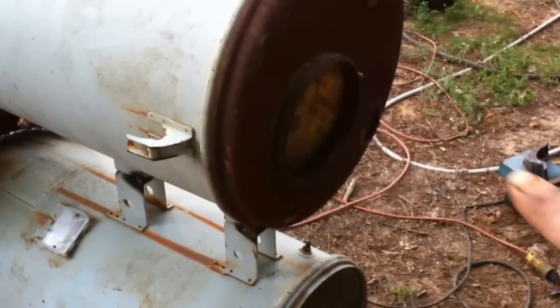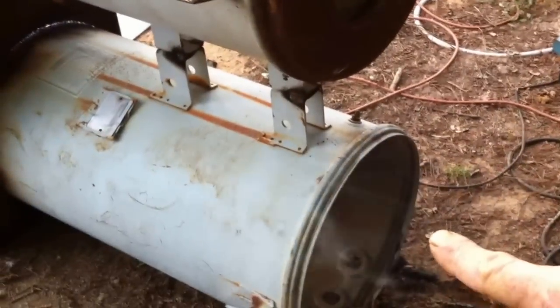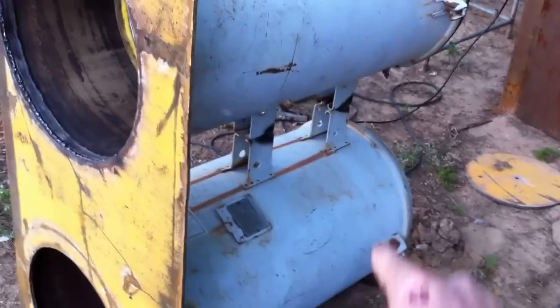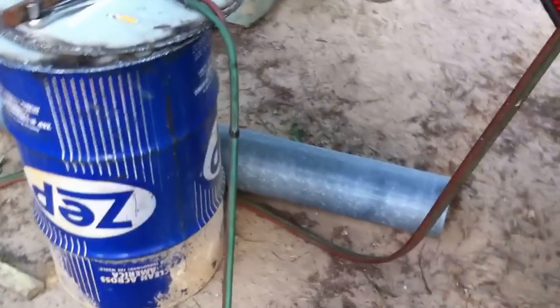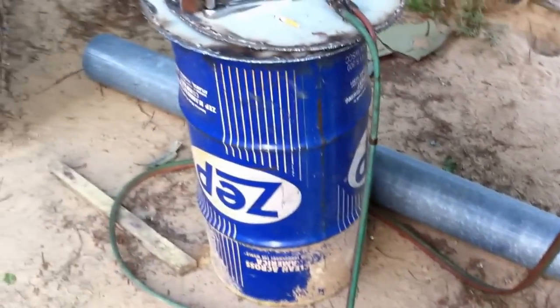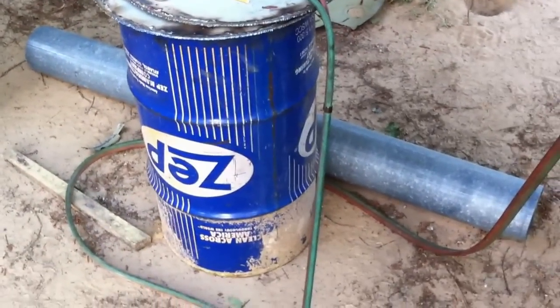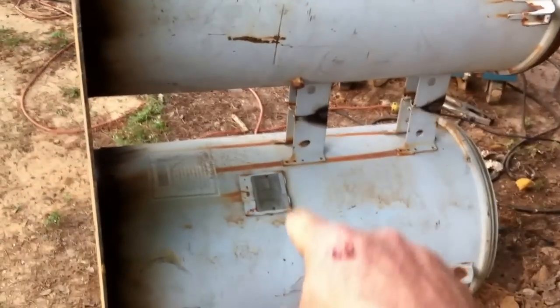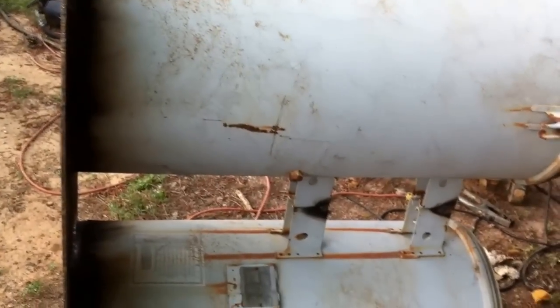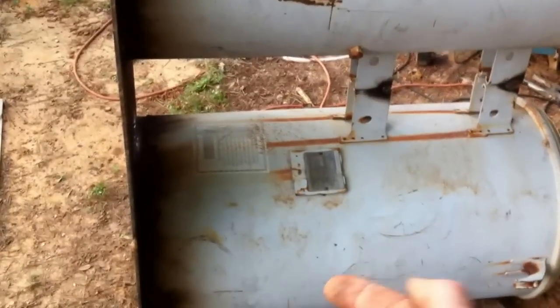Here is the top of what will be on the driver's side, and the top of what will be on the passenger's side. This side will be tailgate. This is the base. Three compartments: one for a clean-out for the gasifier, one for a condensate tank below the filter, and between the two I will have a cyclone made from this piece of pipe here — a cyclone separator to make sure ash and particles do not get into the radiator, which will be coiled back and forth, up and down, built out of thin wall tubing for cooling the gas down before it gets to my filter. The radiator will drain into the base.